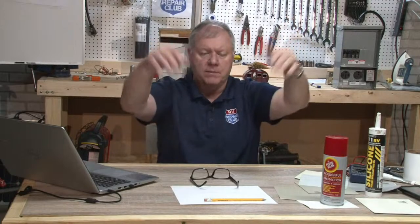There's several places they put fuses over the years, and I don't know every single one of them, but a lot of the diesel pushers, especially Fleetwood, underneath the driver's compartment outside, had a door that would open up and have a full array of fuses in there. Some of them had them in the back where your batteries were, close to the start batteries on your chassis. And then a few of them, like Winnebago, put them under the dash. So your dash would lift up and you saw a fuse block in there. I don't know if that Discovery did it. I know the Bounder was doing that because they had the flip-up dash first. So those are some areas that I would check. And if anybody out there has a Discovery and has come through that, please post this or help him out. Bert, I guess it is.